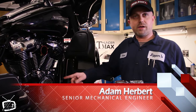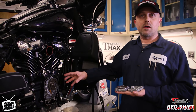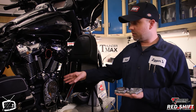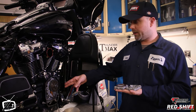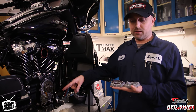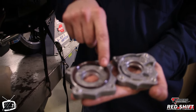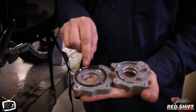I'm here to do an update on JK's motorcycle. We've pulled the cam chest apart and checked his crank runout — it was about four to five thousandths, which is pretty common on a bike with 19,000 miles. I'd have no problem installing a sprocket drive camshaft on that. We found that he had the late oil pump and the late end cap. As you can see, this is an early Harley end cap, and the late one actually has this o-ring seal.